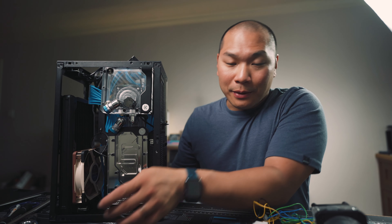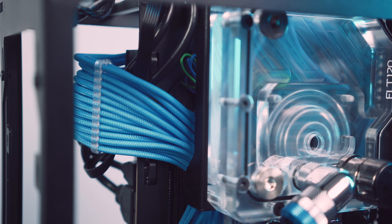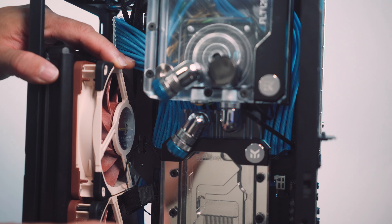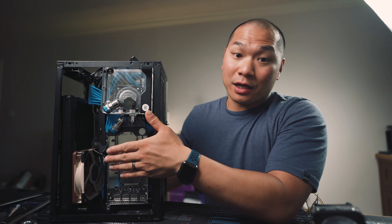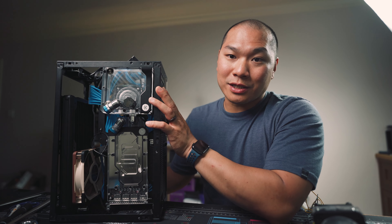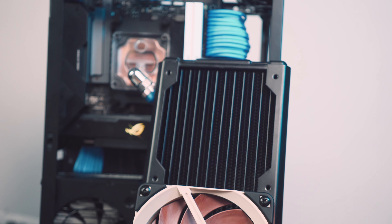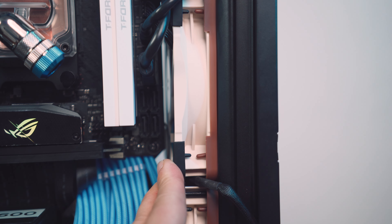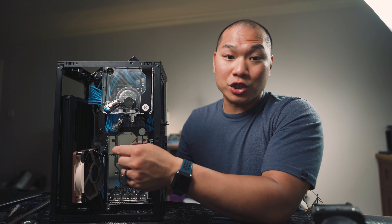Your choice of 240 or 280 also depends on your component choice. I would lean towards a 240 for cable management reasons and because you can use very high quality Noctua NF-A12x25s. But throw something like Arctic P14s on a 280 and you also have a huge amount of cooling potential. For my build, I'm going with a Hardware Labs GTS 240. I'm only running a 5800X and a 3070, so with decent fan speeds I'm confident this will work fine. The GTS 240 rads are awesome — just a hair under 30 millimeters thick — giving you effective cooling and space efficiency. It also comes in a 280. Another similar rad also made by Hardware Labs is the Corsair XR5, which comes in both 240 and 280 and performs similarly, though slightly worse than the GTS 240.